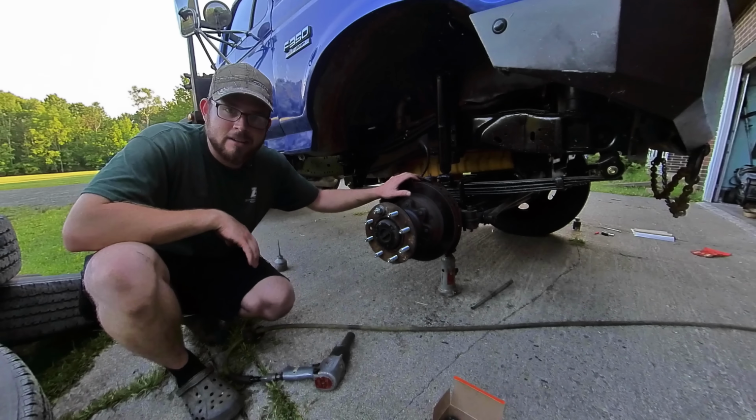All right. We're ready to put the big old tire on. Exciting things. We gotta go up for some reason. I think I got a bad ball joint or something. They call for red Loctite on these when you put them on. The adapter plates anyways. Call for the red Loctite. You guys got me all distracted. Usually I put a little bit of oil in there.